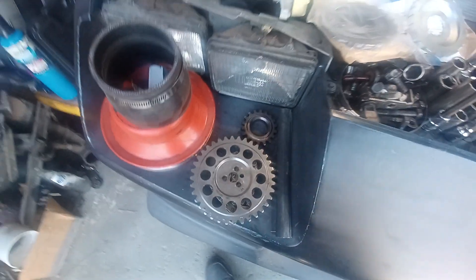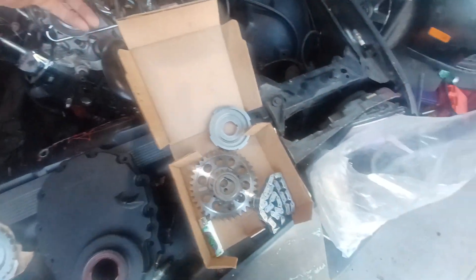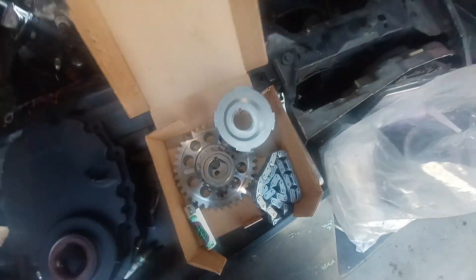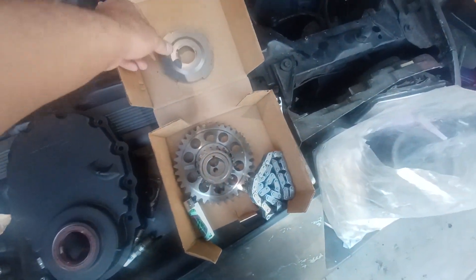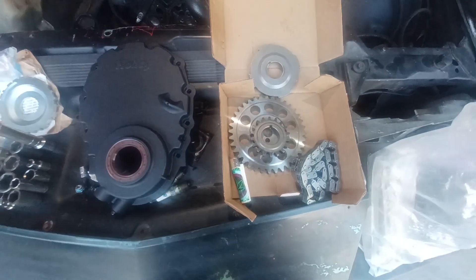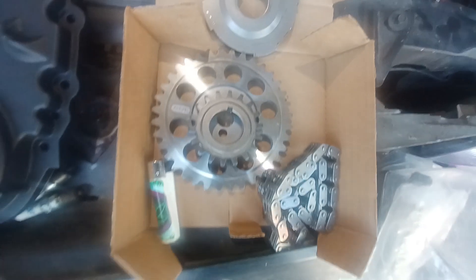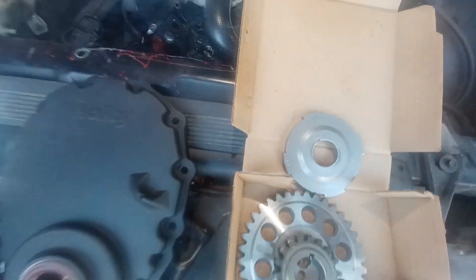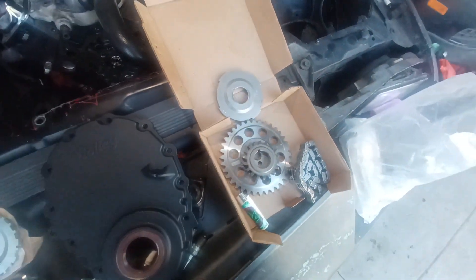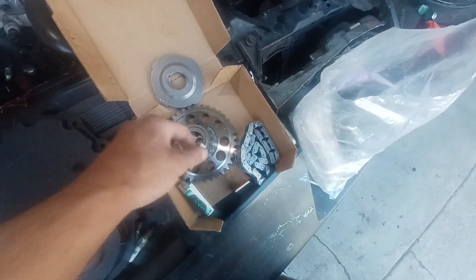This is cheap — last time I set up about 40 bucks with a one-year warranty. But this time, 30 bucks at the AutoZone. Just a little tip for you guys: I was looking for a timing set for a 92 Camaro and they didn't give me any results — they only pulled up some other timing set. But look for a timing set for a 02 Express van. It's the same small block, but they give you more options.